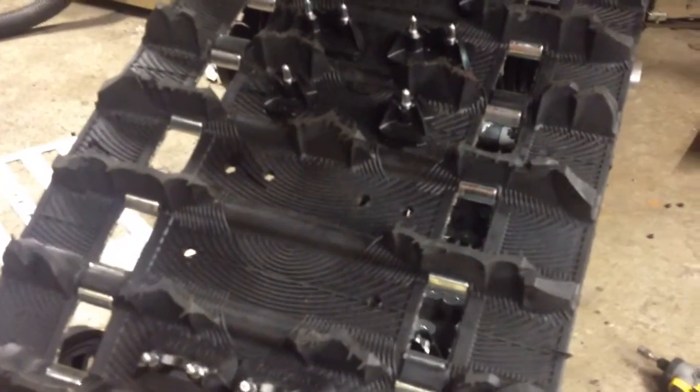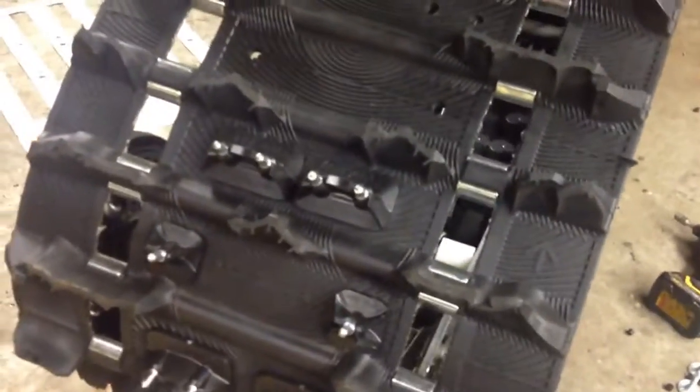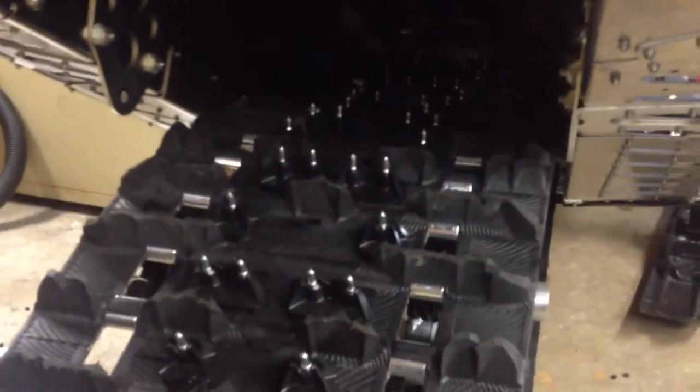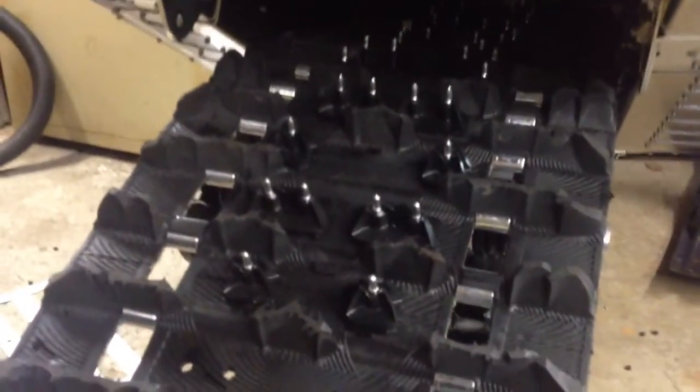They look sweet, and just by looking at them I think it's going to work awesome. I've got my last six to go. I'm a mechanic by trade and this is the fifth track I've studded, and it's taking me about three times as long as any other track. They are much more time-consuming than regular studs and backers — by a lot. Obviously you can't turn the backer, you have to turn the stud, which makes it more of a pain. I'll come back with another review once I've run them and put some miles on. So far they look like they're going to be insane, especially with the supercharged Nitro. Alright guys, take it easy.